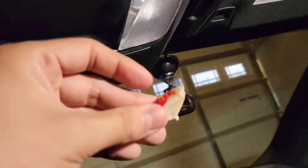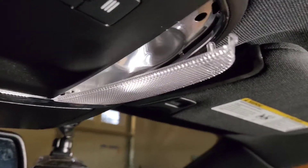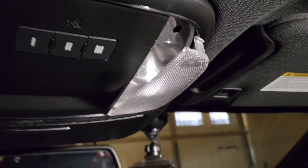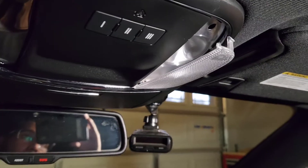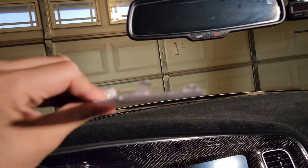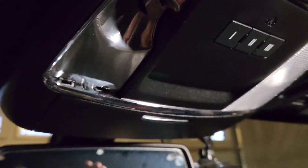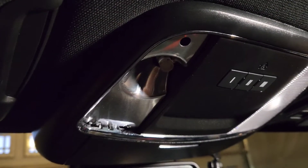I was taking off this side and put tape around it but it just fell out on its own — and it was working, so that's fine. If you can take the bulb out and swap it without removing the housing completely, I highly recommend it, because putting these back on is difficult. The reason it's hard is that these two clips are not parallel, so you have to get them at an angle and also make sure it clips up top. It's easier said than done.